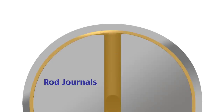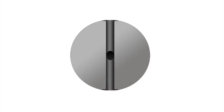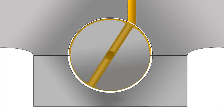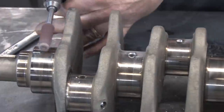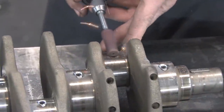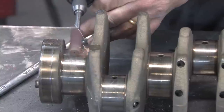This will indeed help oil delivery to the rod bearings, but there's no benefit to doing a directional chamfer on the crank's mains with the 4G63 block. The oil being supplied to the rods comes from the crankshaft's main journal oil holes — it's why they have a bearing with an oil groove against the block. The crankshaft itself is an oil gallery. Every 180 degrees, an oil hole on the crankshaft passes across the bearing, taking turns to maintain a consistent oil feed to the rods. Putting a trailing directional chamfer on the mains would actually pull the oil away from the supply holes and slow oil flow. Grinding only a leading edge could cause it to scavenge oil from the flat halves of the main bearing surfaces. Putting a slightly larger but even chamfer on the mains centers that pressure drop directly over the oil hole and also increases the duration time of the oil supply over the grooved half of the main bearings.